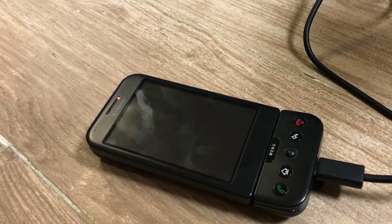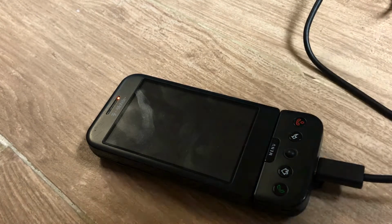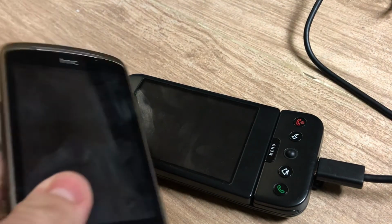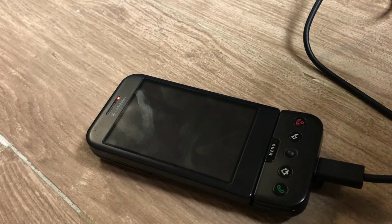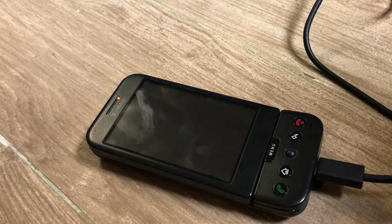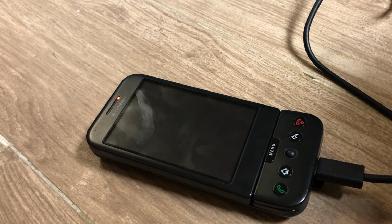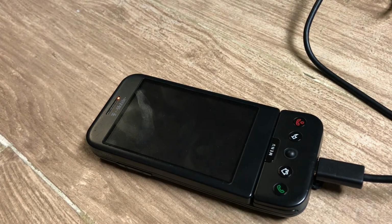Now, if you want apps on these at all, even on the versions of Android like Gingerbread that still supported the Play Store, you have to sideload APKs. Whether you can find some to download through the browser, or more likely you're going to have to sideload them with ADB, which I mentioned earlier, because at this point it's the only way. The app installation isn't the problem. It's more the fact that you literally can't set up the first Android phone anymore.